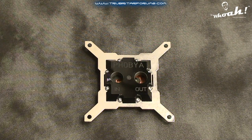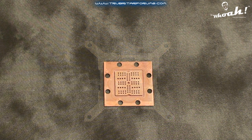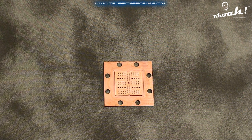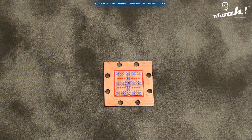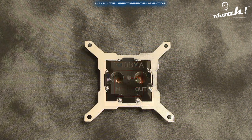Let's have a look at how the coolant flows through this water block. Fresh coolant enters the inlet of the water block and is forced through 65 direct injection points designed to target and provide optimized coolant to quad-core CPUs. Flowing through the cold plate's pin matrix and channeled by the underside of the injection plate, the coolant exits from the edges of the cold plate's pin matrix and 16 larger return ports. The warm coolant then exits the water block.